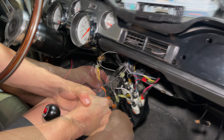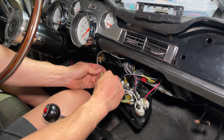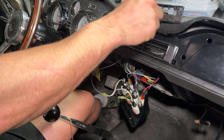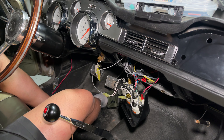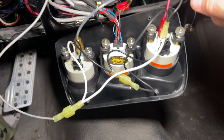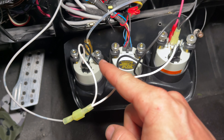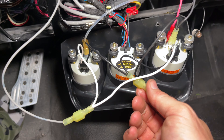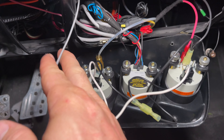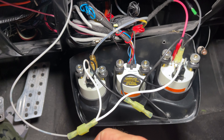The only thing left is to hook up my two hot wires to the light wire that we jumped off the back of our other harness. We'll cut this one about right there and plug it in. I left it a little long because, as I've said a couple times, I might want to move my gauges up here — that just leaves me extra length and honestly it's not so long it's hurting anything. Don't make wiring hard, guys. This is the voltmeter: 12 volt ignition, ground — I'm just using that ground to tie into those light bulbs. I'm going to pigtail those two together and minimize my connections. On the light bulb side we use the switched lighting wire, pigtail those two lights together because the middle one doesn't have one, hook those up and that's it.